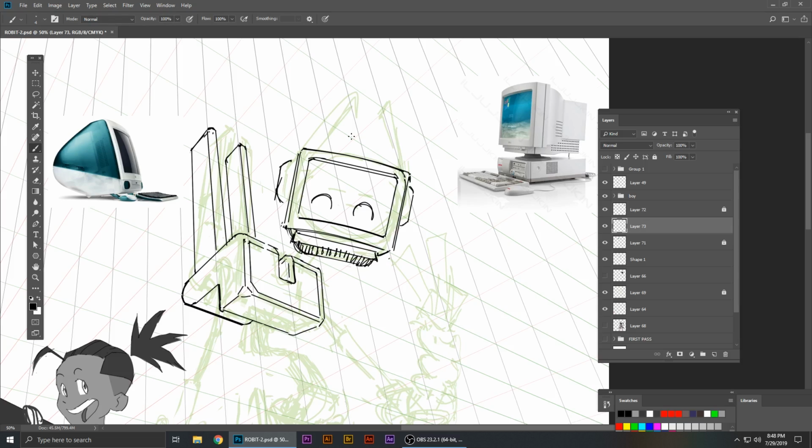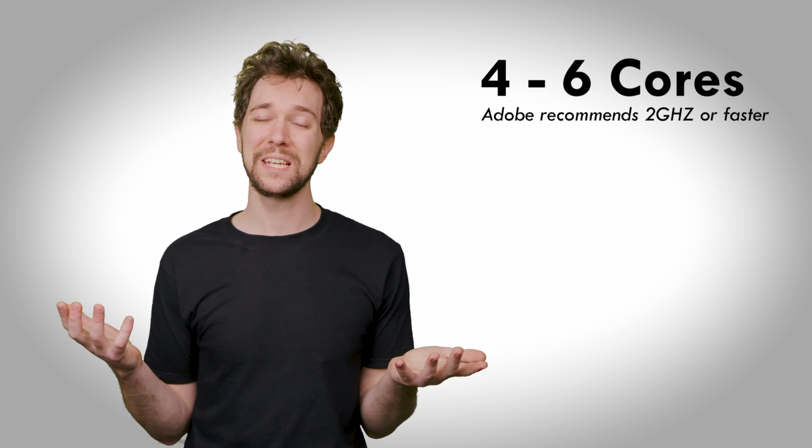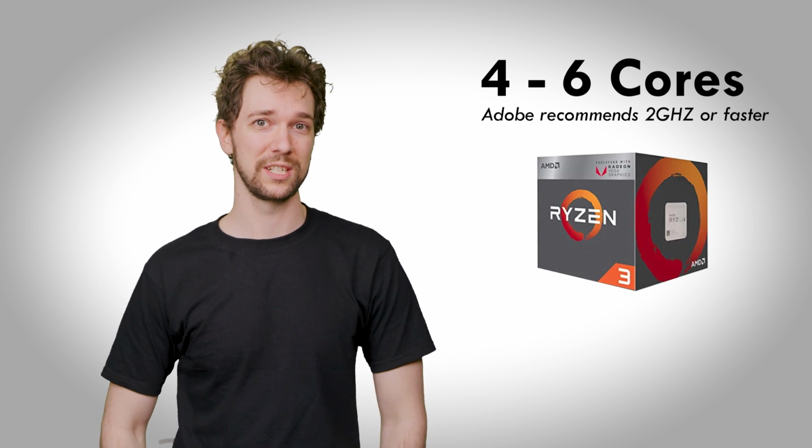Okay, so for modern gaming or video editing, you need a more powerful computer. But if you're just drawing, that's easy. Like, Photoshop can run on almost anything. You can go pretty light on the CPU. 4 to 6 cores is about all you need. Even budget CPUs have 4 cores these days.